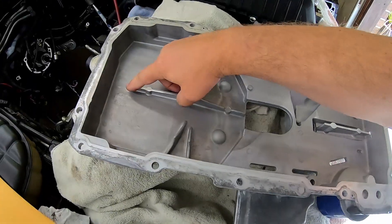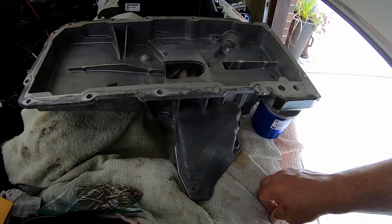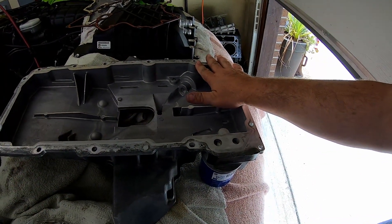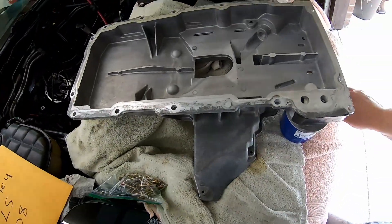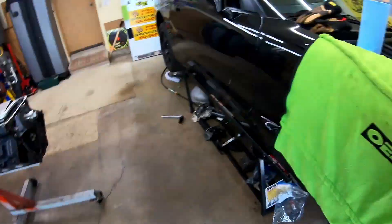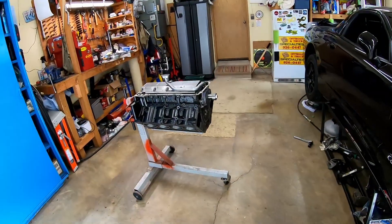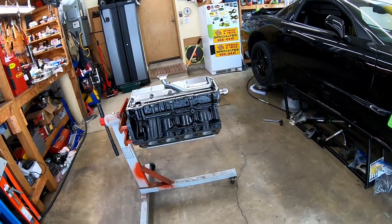With the gasket in place, I found that these center ribs in the C5 Corvette Batwing pan were now resting on the windage tray. So I took an aluminum oxide flap disc on an angle grinder and took 3/16ths of an inch off of these ribs in two sections. Now the pan lays down flat. I also used some modeling clay at two spots in two locations just to make sure when I set the pan on the block it wasn't resting hard on the windage tray — there's about a little bit more than a 1/16th of an inch gap.